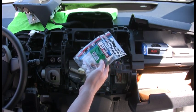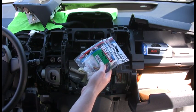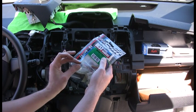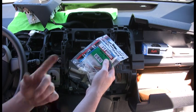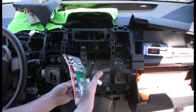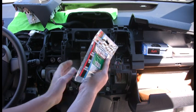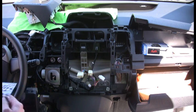I pulled wire from the back all the way to the front, went through the door panel — that's probably the most pain-in-the-neck part of it. In my case, since all I needed was three wires, I could have used one harness and just used T-taps if I knew my color code. But this method is more foolproof — you're less likely to screw anything up and you're not modifying your factory harness, so you can take your equipment with you when the car goes.